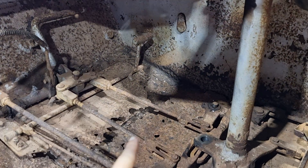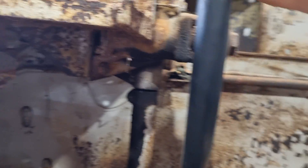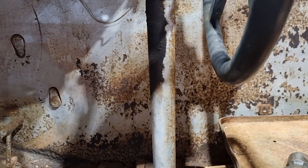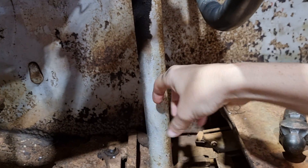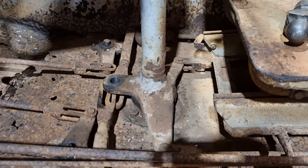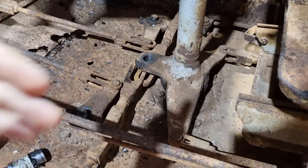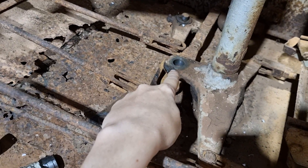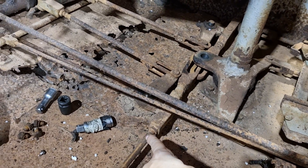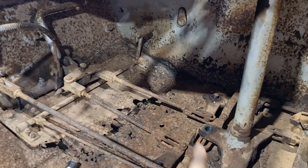The reason there are two is because when we come up to our steering wheel, this just works on a simple right-angle gearing drive, and it turns this whole rod clockwise and counterclockwise, which turns this bell crank left and right. Taking the bolt out of this one, but essentially it bolts into these two here, which are the bell cranks from the brake drums. So these are all connected.